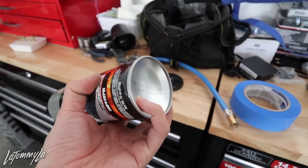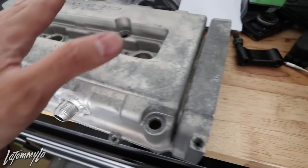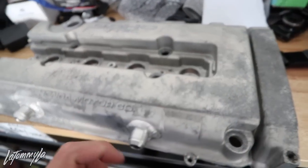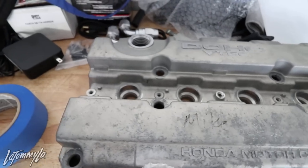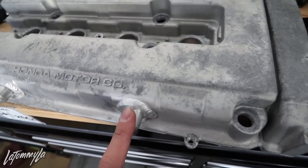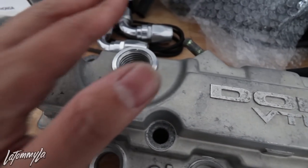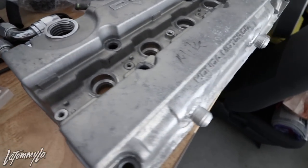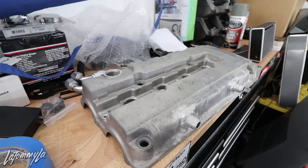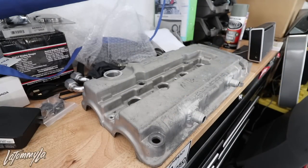Normally what I like doing for the can is heating up the bottom with a heat gun just to get it going. This is already cleaned — it doesn't look clean but it has been sitting for so long. The good thing about wrinkle paint is it covers all of the imperfections because it wrinkles and pretty much expands up. Before I spray this down I'm going to tape off the dash-10 bungs, the spark plug holes, the oil cap, and the breather. I'll be doing that with scotch tape — it's easily removable and doesn't leave any residue.